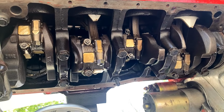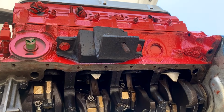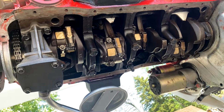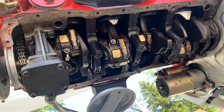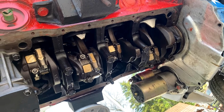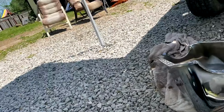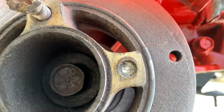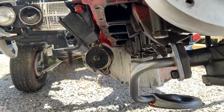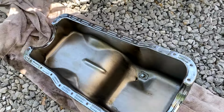So that's awesome, right? I might just go ahead and finish getting the stuff I need to get this to fire up. So it's going to mainly consist of an exhaust and a distributor. So, all right, let me get back up off the ground here. Finish putting an oil pan on. I think it would be just about set to put it down in there. Couldn't get the bolt out, and I'll just pull that balancer off later. If I can bump my welder up there and weld that out or not. So, all right, we'll be back in a little bit once we get an oil pan on it, which is just about ready to go. I'm just gonna silicone it to the pan and slap it on there.